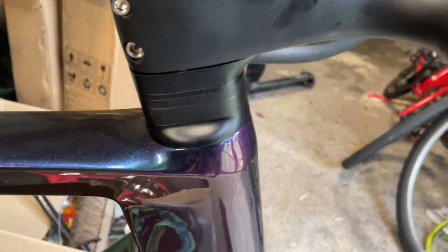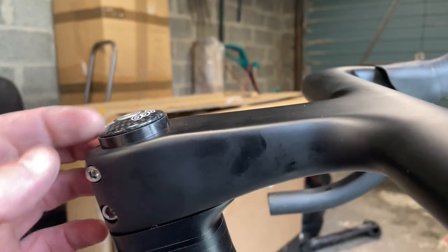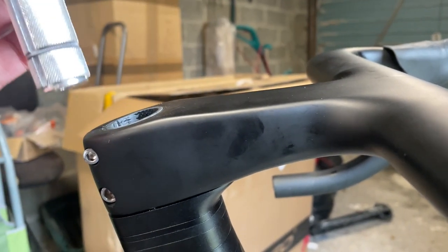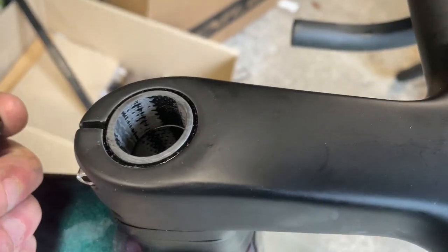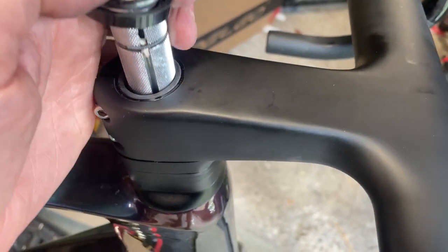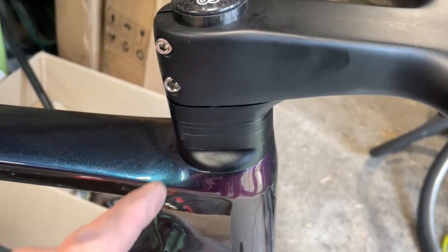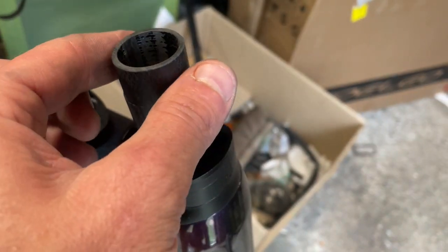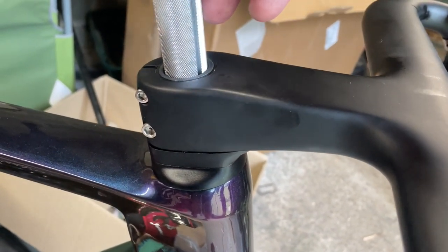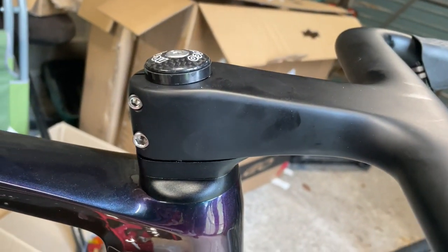That's all cut down and we've put it in. This is the maximum number of spacers I can have. I've got a 5mm ring there and a really long compression plug — that is the two parts stacked together. You can see that line just in there, that's where it's cut. So I can put that in, push down on the stem and compress everything. I've taken the top off, this piece is just going to be removed, then put the top one back on and drop the handlebars on. Handlebars are on. Plug can go in, 5mm spacer, and that will push down on there. So that is perfect — I've got scope now if I want to reduce my spacers.